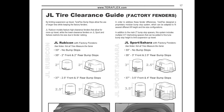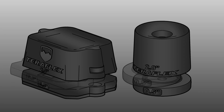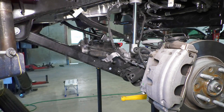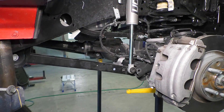Included in the written instructions is a tire clearance guide, which is a good starting point for running larger tires on the JL Wrangler. The idea behind modular bump stop strike pads is to allow a customized strike pad height. To optimize strike pad configuration for maximum travel and clearance, careful setup and testing will be required. Lower the vehicle or raise the axle back up into place. The spring isolator can fall out of position, so make sure it aligns correctly.